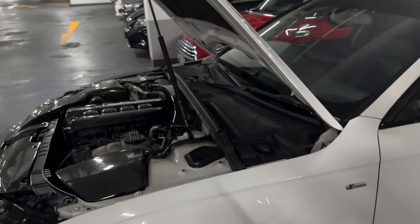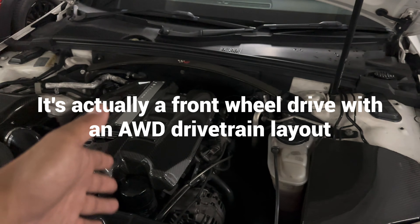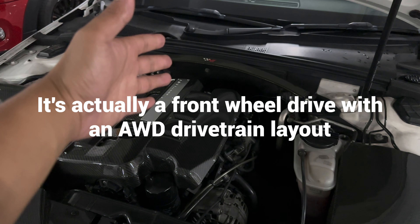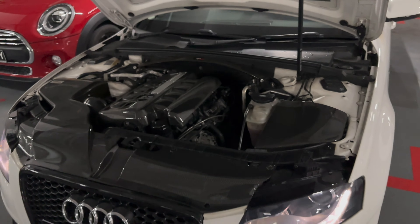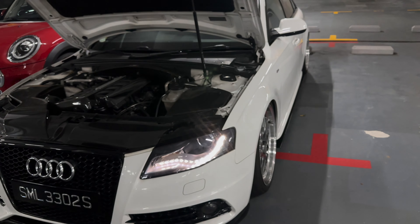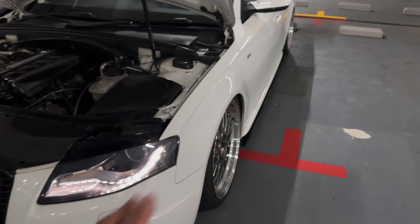Right here, that's a finger gap which is about 15 to 20 millimeters. This A4 is actually an all-wheel drive and the engine is mounted longitudinally, so it does not look like the ones from the A3 that we did before. We're gonna check underneath the car to see if the axle is already hitting the chassis — if it is, there's no more going down.